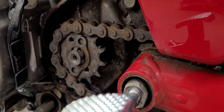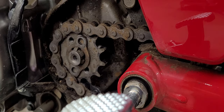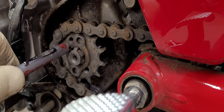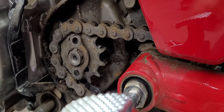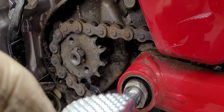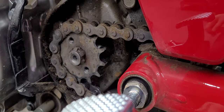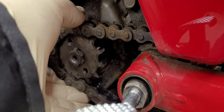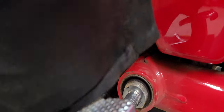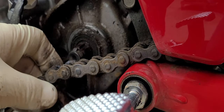You don't necessarily have to have a magnet, but it might make it easier. Once you line that up, it'll come right off over that output shaft — countershaft we call it. See how it's splined? When these line up, that won't let the sprocket come off. Easiest thing to do is make sure you've got plenty of slack in your chain. Walk the sprocket off — just like that. Get it out of the chain.